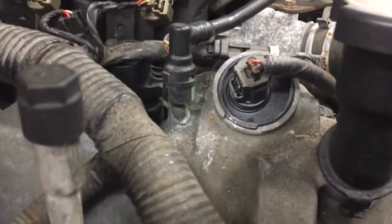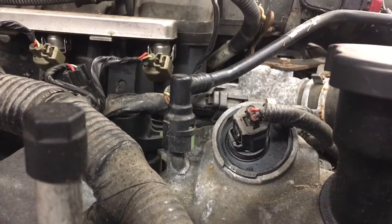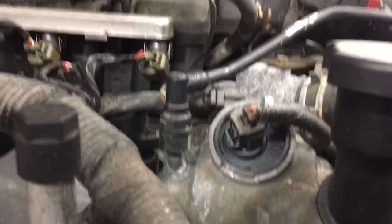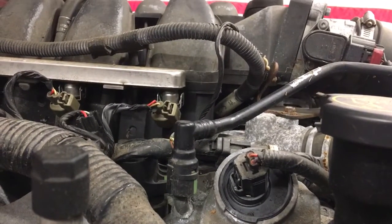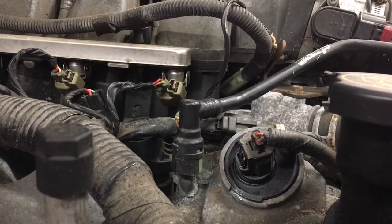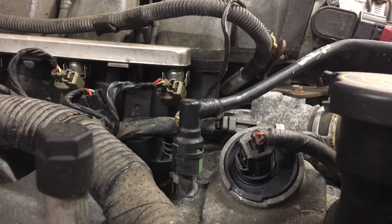So there it is. That is the actual actuator, and it typically gets mucked up internally. The passages get dirty and so forth, and you're not able to figure out what's going on. It's actually because this thing gets clogged up. Getting clogged up means that it can't move camshaft timing, so it winds up making the actuators at the front of the camshaft get stuck.